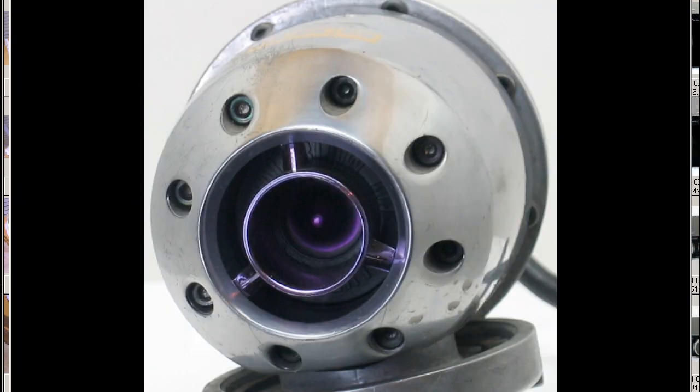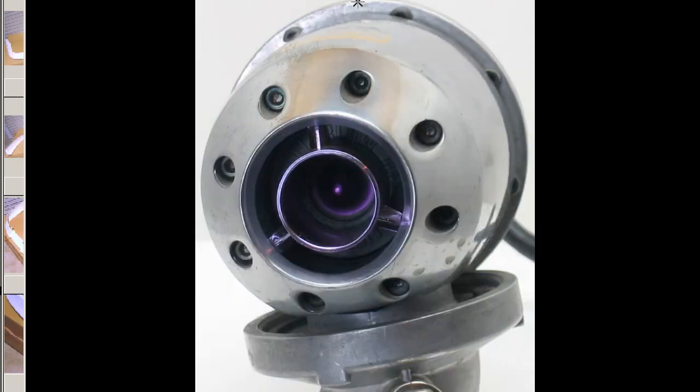And the front of the valve with that distinctive HKS look. This is the little piston here that pulls back, and the boost squeezes around the edge here, giving that chirping sequential sound. The flutter is achieved by the fact that it has a diaphragm in the back that pulls on this piston.